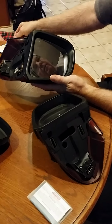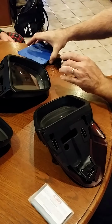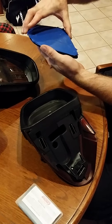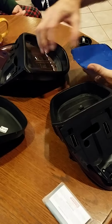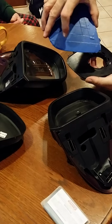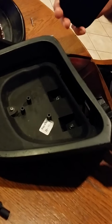The way to repair these is actually by delaminating the mirror glass from the mounting backing plate. The mirror glass fits on the backing plate with two-sided tape, and it comes off. You have to very gently pry into the mirror, heat it up first, get as many spots as you can, and then very gently pull it off. It came off, in this case, without too many problems. I taped it up, obviously, to help stop it from breaking. So what we found from trial and error is you've got to remove this mirror from the backing plate.